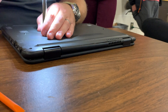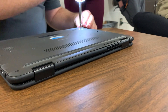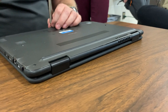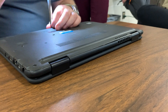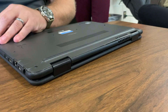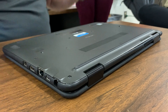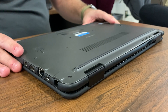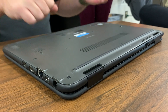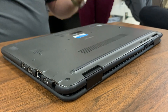Question about battery: when should you replace it, and what clues tell you it's failing? A student will come in and say they plug in the charger, but when they unplug it, the laptop just turns off. Or it charges to 100% but within five minutes it's dead, or it says 70% and when unplugged it drops to 1% and dies. Those are all typical battery failure modes. You can plug in another charger to see if that makes a difference, or leave it charging for an hour, then unplug it and watch it drop to confirm it's the battery.